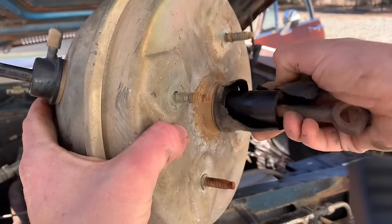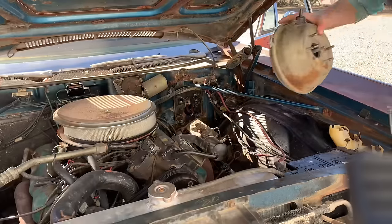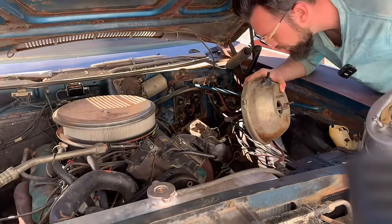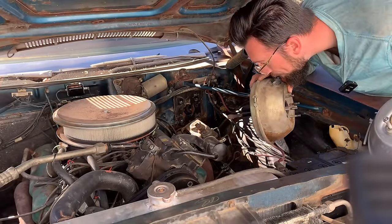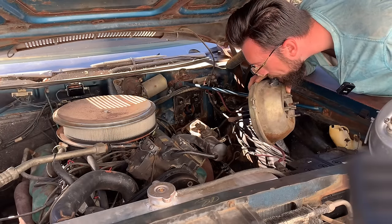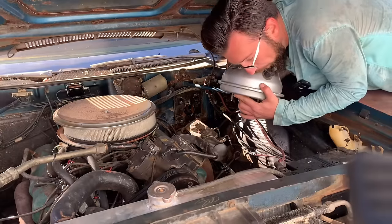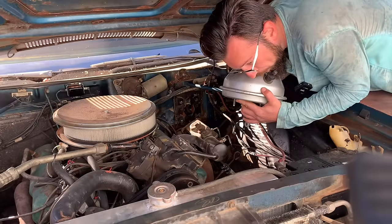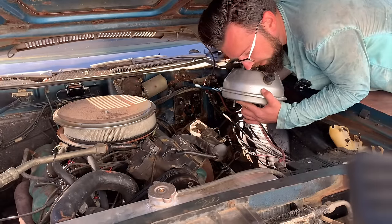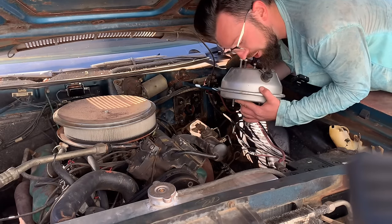The rubber on this — I mean, that's just pitiful. I think my mic can pick it up, so I'm going to just blow through this right now. I could just blow right through that. See how it comes back out — it's holding vacuum and when I let off it's pushing it back out.